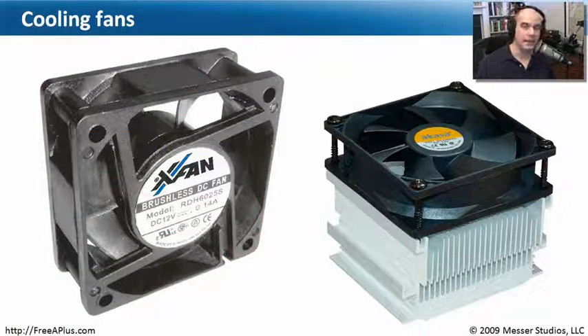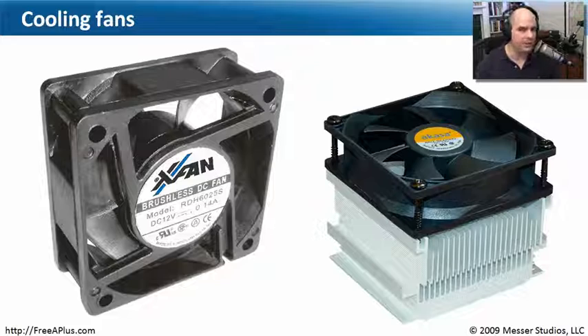Cooling fans also come in different shapes and sizes depending on the size of your system, how hot the CPU gets, and whether it's a laptop or not. Yes, even laptops have fans inside of them to keep things cool. Some fans are designed to cool entire systems; others are designed to sit right on top of a heat sink which sits on top of a CPU, so that it directly cools the chip. So when you open up your computer, count the number of fans you have and try to figure out what each one is trying to cool and how the air blows through your system, which will have a dramatic effect on how you maintain that airflow throughout the entire life cycle of your computer.